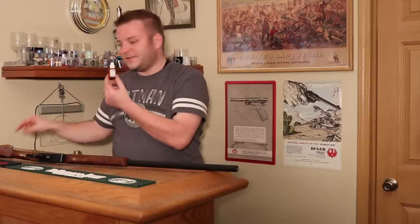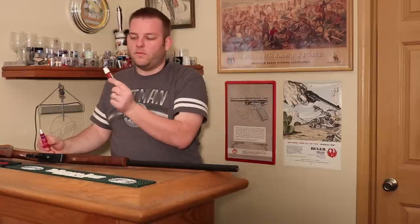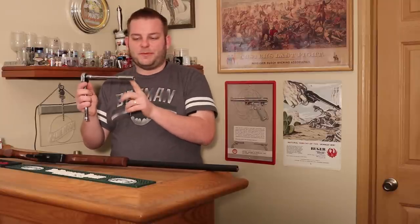Before we start you're going to need a few things. You'll need some threadlocker — blue is removable or semi-permanent, red is stronger; I'd recommend going with blue for this job. You'll need a half-inch socket — a long tube and extension are probably required, though two extensions would work. You'll need a Phillips screwdriver, and you're going to need some gun grease. I like to use the cheap moly lithium grease from Walmart in the auto section — it works really well. That's pretty much all you need.